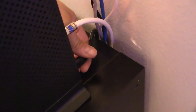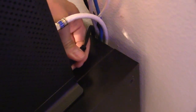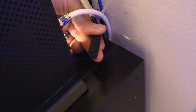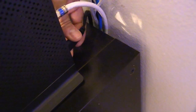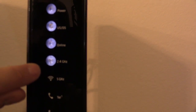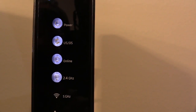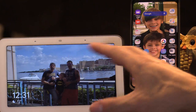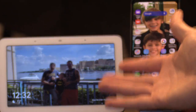If you're still not connected to the network or the internet, you want to find your wireless router and unplug the power cord for one whole minute. Once you unplug it for one whole minute that resets the router. Wait for all the lights to turn on before trying again on your Google Home Hub. That hard reset fixes many different issues like internet connection and network connection.